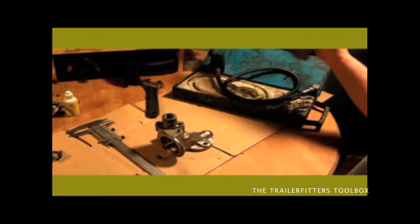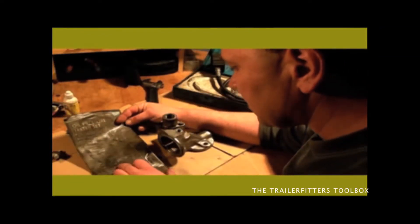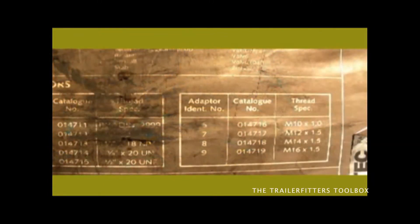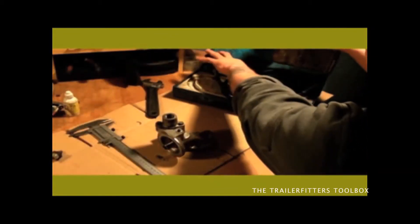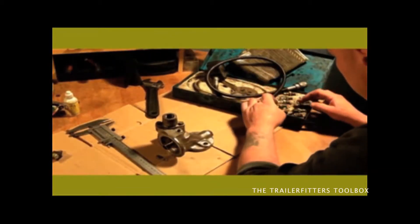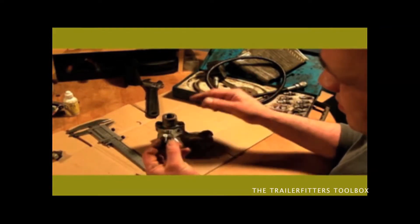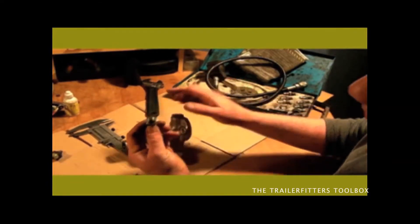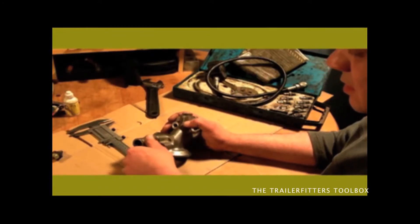I'll look up our chart here which will tell me the adapter. I'm 10 by 1. This is getting rather oily and that's adapter number 6. Adapter number 6 — that's this one. It screws right in there as you can see. I've got a sealing ring just to make sure the oil doesn't spew when you're actually running the engine.